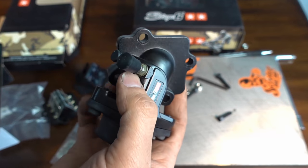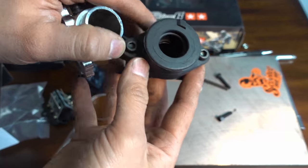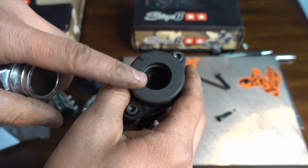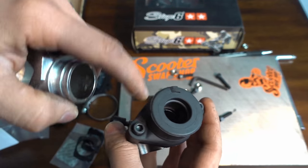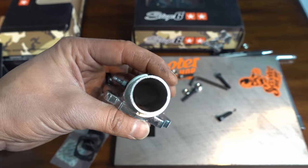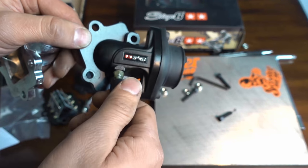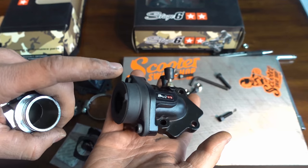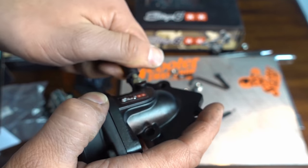The manifold itself is a totally different design. On the Goofit it's got a rubber coupling to connect to your carburetor, whereas this one has a two-bolt flange, which is really nice and easy to change. The Stage Six comes with a manifold design for Dellorto or 21mm CP — something like that. If you want to go to a larger size like 24 to 30mm, we sell those and you can order them separately. Good quality brands are going to be 24mm and larger. These carb fittings definitely have a nicer finish — they provide you with a couple of rubber boots as well.